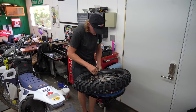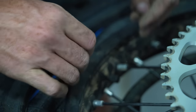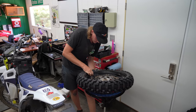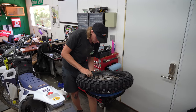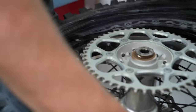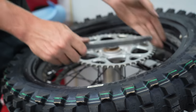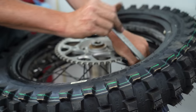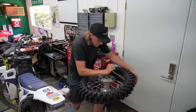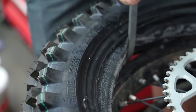Put the tube inside the tire, then put the rim lock in. Get the nut started on the rim lock, push the valve stem through and get that started just a little bit. This part can be the most frustrating — just take your time. Instead of ending on the rim lock I like to start on the rim lock. Once those are started, set up the bead buddy and get that underside bead over — just one more bite and then we're home free.